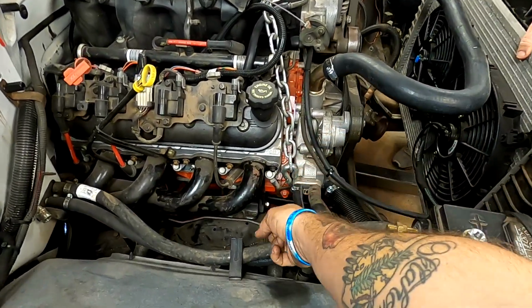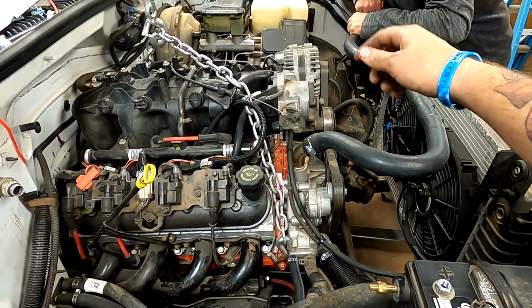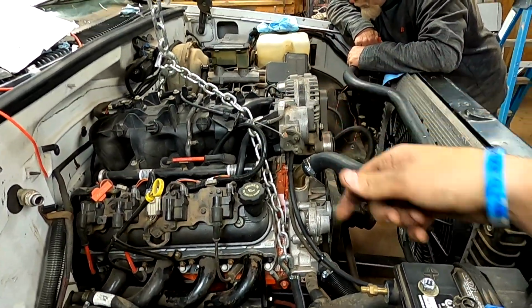Got one, I think it was this passenger side we got in first. And then we moved the motor to get to the other side. If you're having to mess with this, you really do want to get one clamshell bolt in, because that basically gives you a pivot point for the motor to come down, right? So if you have one started, that straightens you out side to side, and then all you're doing is hinging the other side down into its hole. So we got that done.